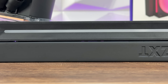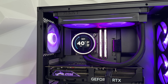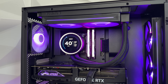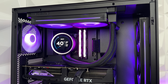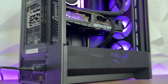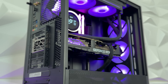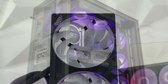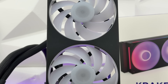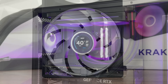The pump block is 93.5mm wide and 65mm tall, with a plastic cap and ring, copper cold plate, and plastic housing. The radiator is 280.1 x 120 x 27mm aluminum. Tubes are 400mm CIIR rubber with PET braided sleeving. The F240 RGB core measures 240 x 120 x 26mm, max 2400 RPM, 75.12 CFM airflow per fan, 3.3mmH2O static pressure, 30 decibels per fan, fluid dynamic bearing, 8 LEDs per fan, 8-pin PWM and RGB connector, and 600mm cable length.